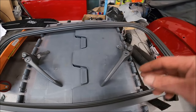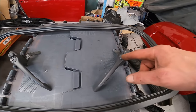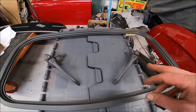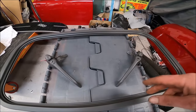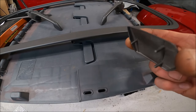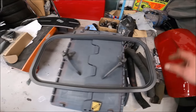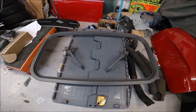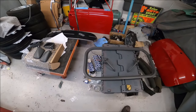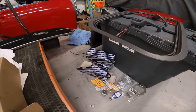I had to re-spray the door handles because there's a little chip there and there. Now I've got to take the push button and cylinders out - these aren't the original handles - so I'll take these apart, take the originals apart, and put the original locks in. That's the bonnet badge, all sprayed in Nimbus Grey with the turbo badge sticker. And the sunroof outer rim - I've sandblasted that in the cabinet and re-sprayed it in Nimbus Grey, so that's ready to go back on. I've got new wiper and indicator stalks for the steering column.